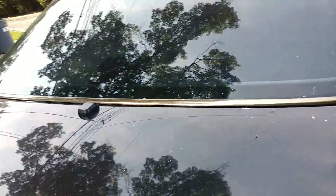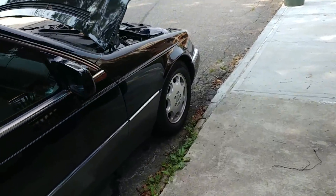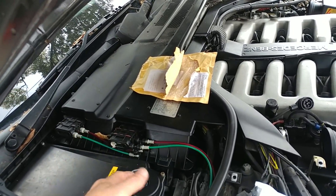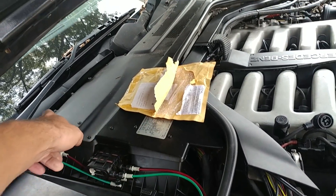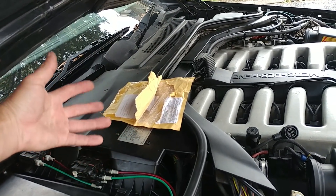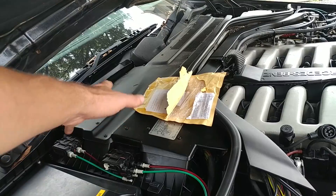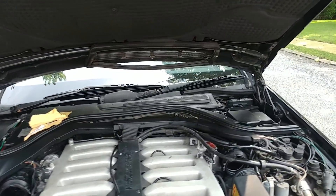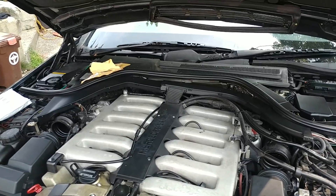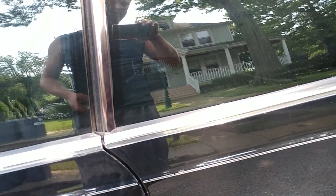I'm also changing the air filter because the air filter is in ridiculous condition. The drains were all clogged up — it actually overflowed water inside the outside air cleaner, and the filter itself was completely destroyed, in terrible condition. I'm changing that as well — not an expensive part, but it needs to be done because you don't want that musty, nasty smell in the car.